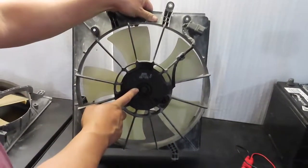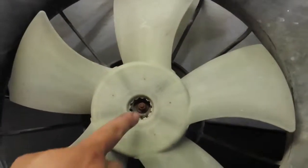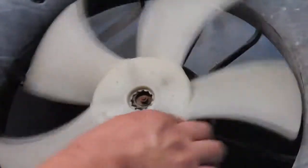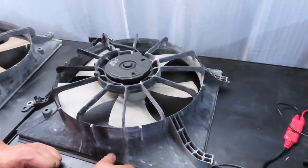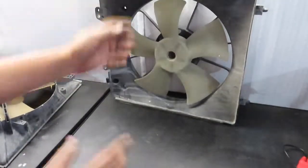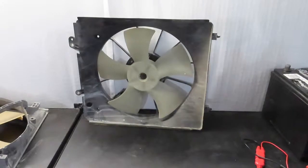It could be the motor is burnt out, and I don't think that's the case, but it looks like this fan is, as you can see right here, knocked out of where the connection is. So it actually is kind of stuck, so it won't turn. So basically this motor, or this fan, is done for. So it needs a replacement, and you can either buy the fan and replace it by itself. Of course, it looks like there's 3 screws and it'll come right out, or you can buy the whole assembly. I'm going to grab a Phillips screwdriver here, and there's 3 screws, and we're going to go ahead and release that fan from that housing.